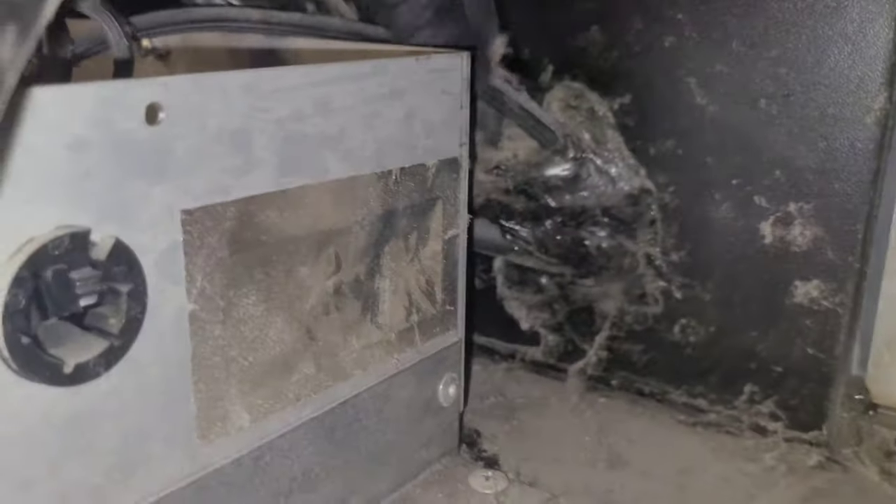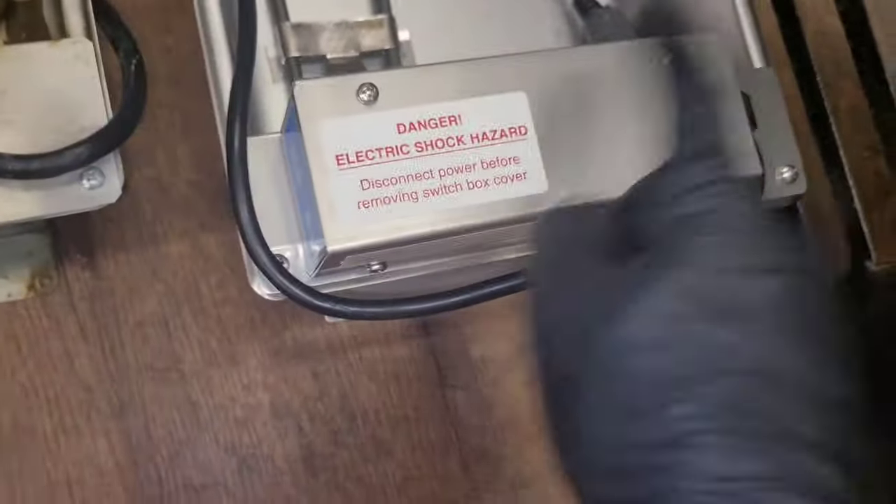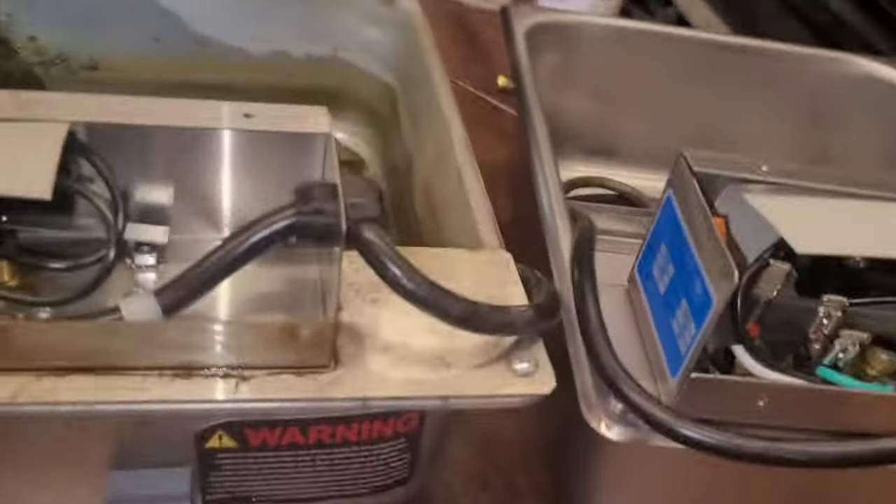When you look on the other side of the unit at the black caulking — oh my god, look at that coil, wow, going to have to clean that. This caulk is really really strong and really nice, so instead of ripping this old cord through there and running the new one through it and trying to recaulk it, I'm going to leave this in place. I'm going to unwire it from the old pan and mount the existing wire to feed the new pan. It's actually quite simple — it's the easier way, and it's neater, more professional, and it lasts longer.